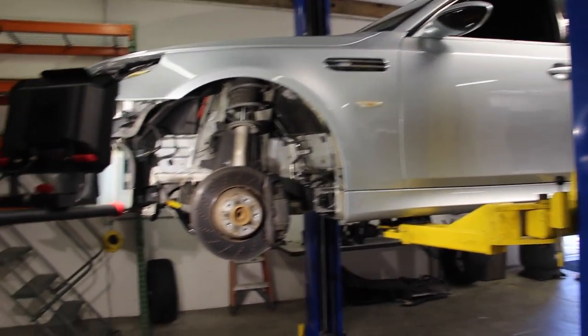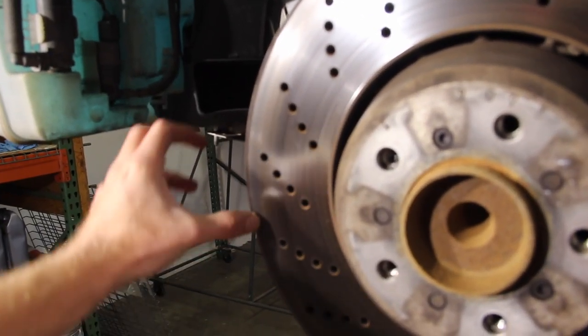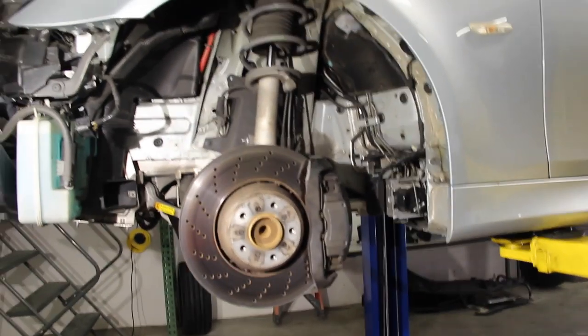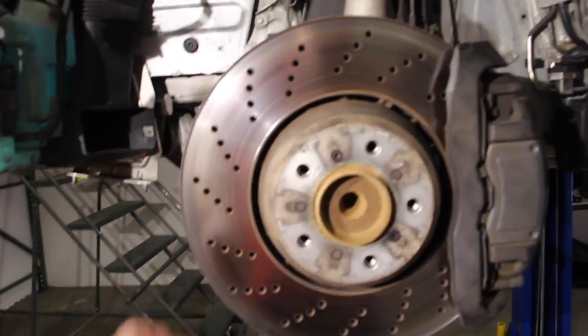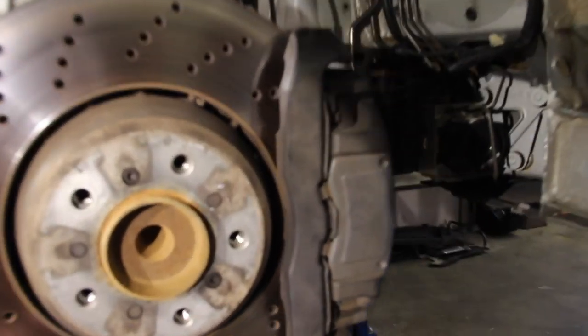It's got 100,800 miles now. Original rotors, quite a lip on them. You can look at your rotor and feel it - if you feel a big lip or a dish, it is time to replace your rotor. There's really been no symptoms of brake shuttering or fade or anything that would indicate needing new rotors, but we're doing so much on this car right now, there's a hell of a lip, so we're just going to replace them all. So four rotors, all the pads. These pads have about 84,000 miles on them.